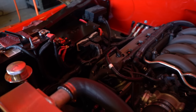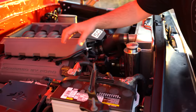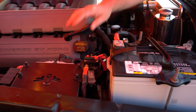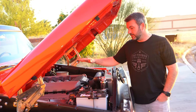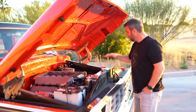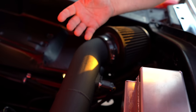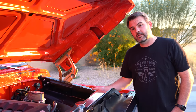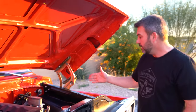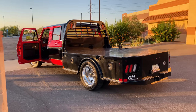On a Coyote, the Mustang harness comes out right here and will plug into the computer. We've actually designed a little computer box right here to plug this in. You could cut it back open and stretch the wires out and tuck it underneath the dash or underneath the seat, but for here we want to keep it pretty traditional and straightforward. We've got our cold air intake which we've built, and our MAF sensor right here. When you're building a fuel injected system, you definitely want to keep that at least a foot away in the straight part of the pipe so it's going to be metering the air precisely. We've got a new Ford power steering box — whether it's Napa or O'Reilly's or AutoZone, just get the Ford Motor Company power steering box and have that rebuilt. Ends up being the best.